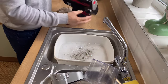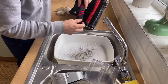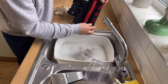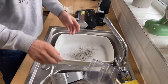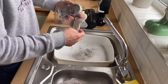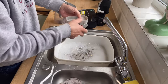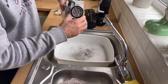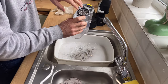I'll just quickly show you how to put these back in. That end — the bottom where the catch is — just lines up. Once you hear that click, you know it's in place, so that's ready to go. For your filter, obviously make sure it's dry. The really thin one goes in first, that goes on top, and it just inserts in there when you're ready to go. Make sure they're all dry before you use them on the machine.